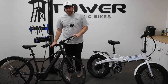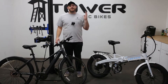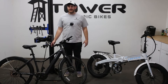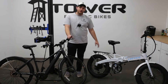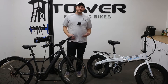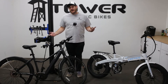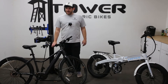Now that we've checked those out, what are the awesome features and not-so-good features, and which is better for you? Starting with the pros of belt drive: belt drives perform very, very well — they're smooth, zero noise. Most of the time when a bike has a belt drive, the components are pretty premium, which you will definitely feel while riding. Another really nice feature is they're very low maintenance. A regular bike chain you have to lube, clean, and occasionally replace. These Gates belt drives require no lubing, no cleaning — they're basically self-sufficient until the teeth wear down or the belt breaks, which is usually many miles and many years into owning the bike.